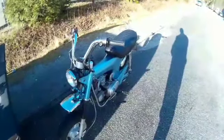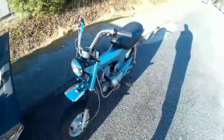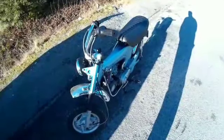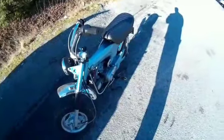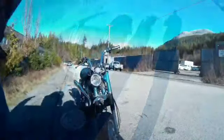I'm out on a popular spot for people on dirt bikes — a gravel road outside of Maple Ridge where I live. I'll just stick to the gravel roads and try it out. I'm back to the truck and it's still not running right. I'm going to take the needle out of the carb and move it up a notch — lean it out — and see if that makes a difference.